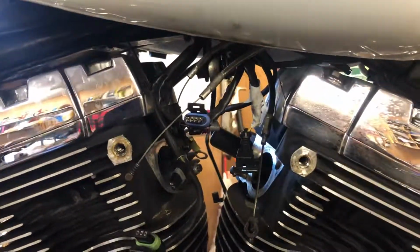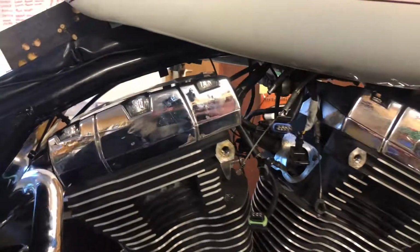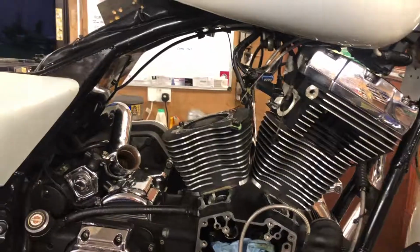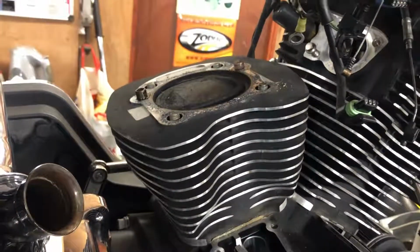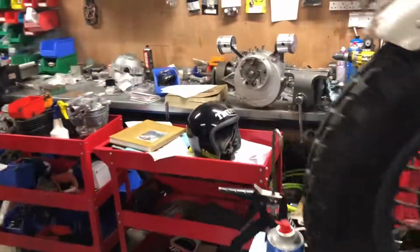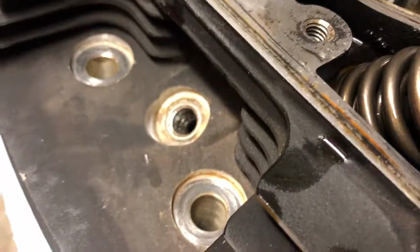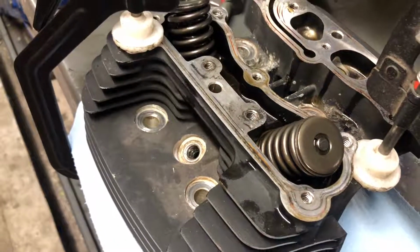I've kind of jumped ahead a bit, basically because I forgot, I can't remember everything. And I've got the inlet manifold off already. I've got the rocker cover top bolts out, so it's ready to slide out. But I'll rip the head off just now and I'll let you see us doing the thread insert. Now, that's us, we've got the head off. The gasket surface still scraped, still got the back cylinder to take off, but we'll get to that in a wee minute or two. It's over here, I've got the head clamped down, so the threads, or what's left of the threads in that hole, and they're going to make this next part easy because we're trying to centralise the tap to get the insert in there, but we'll get there.